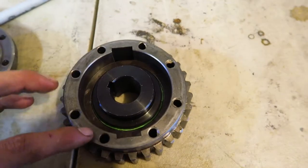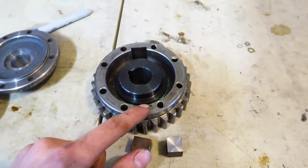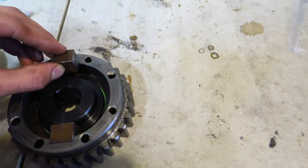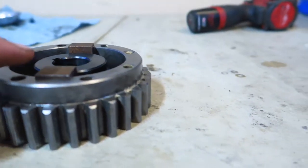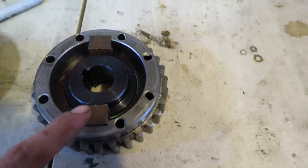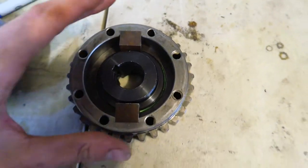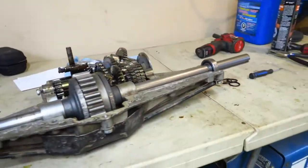With those pieces fitting perfectly in the center, I can now work on getting the bull gear to spin with my axle shaft as one complete unit. From the factory it comes with little three-quarter inch recesses in the bull gear. The idea is to lay down some stock and insert pieces into those slots. The issue is they protrude out of the casing, so I need to lay down more material to get them flush, bring the collar up a bit, weld the ring to the lock hub — and we'll have one spinning assembly that can be removed if the bull gear ever loses a tooth.